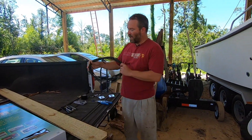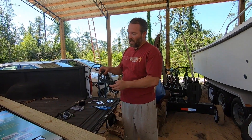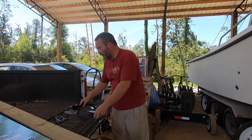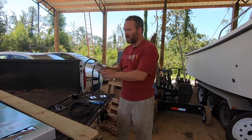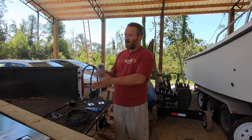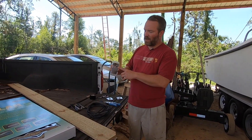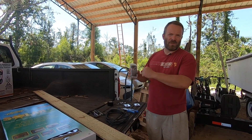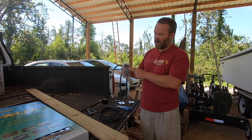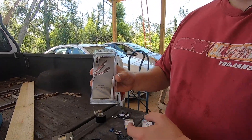Next up is landscape cable — this is 14 gauge and a 25-foot run. I felt comfortable with 14 gauge because that would keep the current flowing nicely. We've also got an adapter here for the two flat wire, so we can keep the same connections that came with the solar panel. That way we don't have to cut their flat cable, making it easier if you want to take the panel down and plug in the OBD2 adapter or cigarette lighter. We're going to splice these into that 14 gauge wire — the adapter was about two dollars and fifty cents.